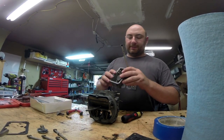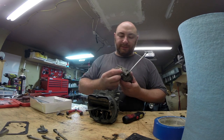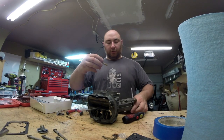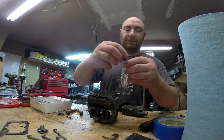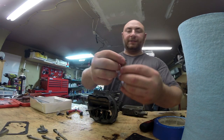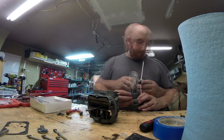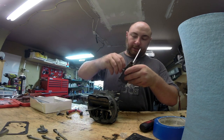Now that we've got this sitting on here, remember this is the side that has the accelerator pump in it. The first thing you're going to want to do is remove this screw right here — this actually has a hex part right there, and if you push down on that hex part it has two slits cut into it. To pull out this, which is the fuel limiting device. So you want to unscrew this top brass screw, set it aside — we have to reuse it. There's a little gasket here which we won't reuse. This part slips off — you can see it's just grooved to fit — and we have new ones of these regulators as well as new gaskets in the kit. Grab one of our new ones, put it in here, set the new gasket on there, grab this guy and use the key to screw it all the way in.